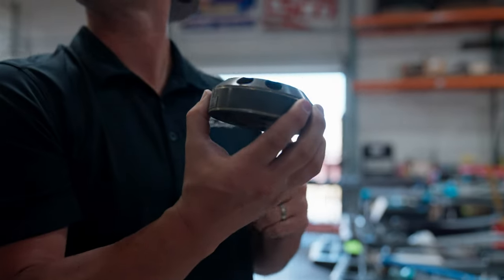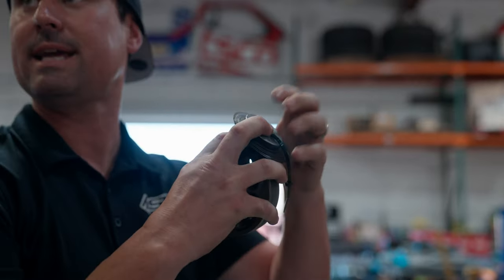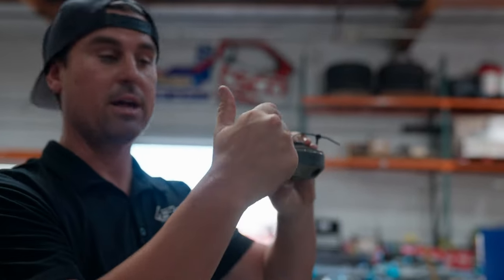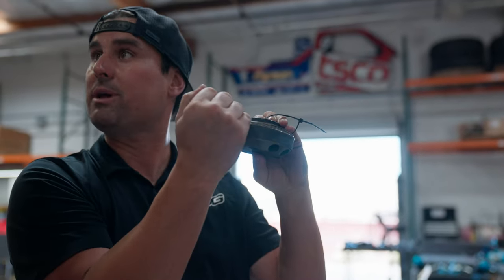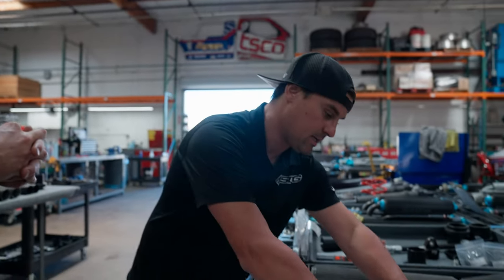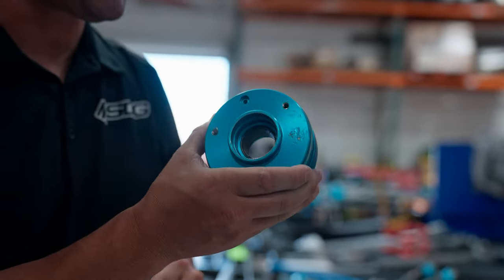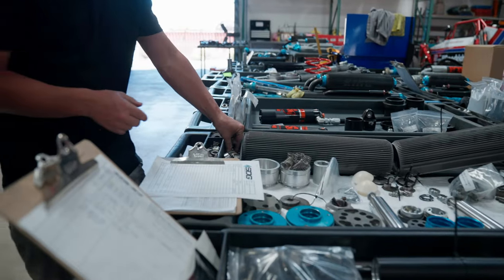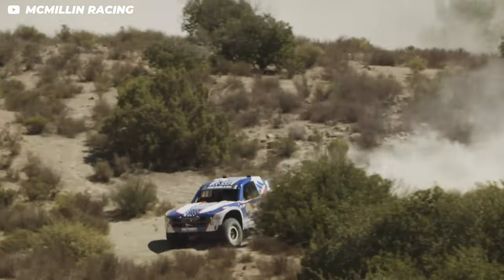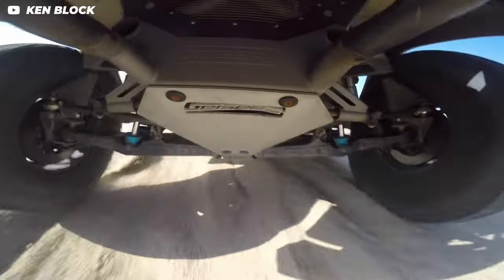The hard parts don't wear that much, but there are components that do wear over time. The shims get bent repeatedly and can stay flexed open — the metal has memory — so eventually you need to replace the stack. There's also a DU bushing inside that the shaft rides on. On the rod ends there are sphericals, and as the shock goes up and down, water and dirt get into those bushings and wear out the Teflon inside.